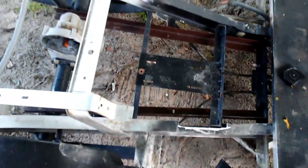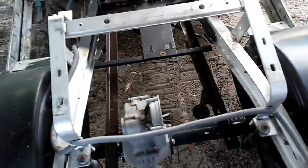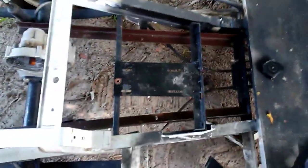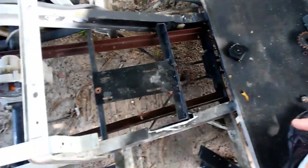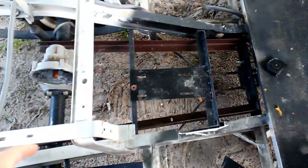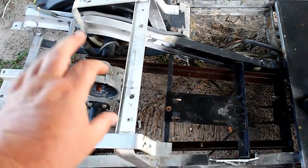This will be built more to my liking and my custom build than anybody else's. Plus, when the rear end moves up and down the motor will move with it, so that eliminates tensioners and all that. I'm going to grab another bracket, get it cut, get a hole drilled through it, and a bolt mounted in the front. Then we'll work on the back, get some pieces welded on to make it square instead of just an L.